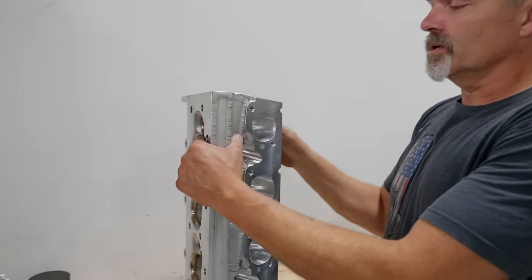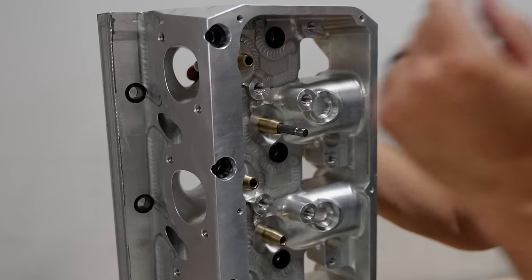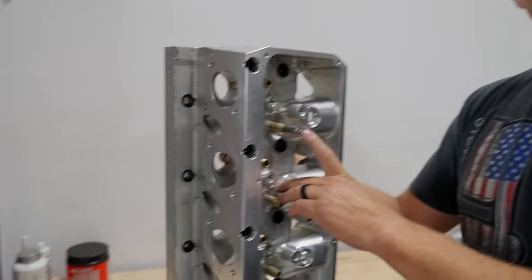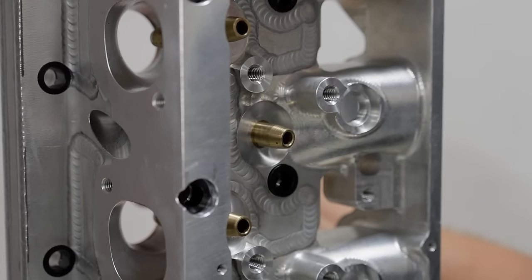Now, if you know how this stuff works, they had taken the valve spring off and they had air pressurizing the cylinder. Problem was all of a sudden, I don't know how, all the air left the cylinder. This valve literally fell all the way down to hit the bottom of the piston. They show me what happened. I look down in that hole and I see the valve down there. So I'm just sitting there thinking, I don't know. Holy cow. Well, our worst case scenario is we have to take the head off and fix it.